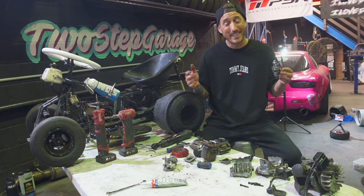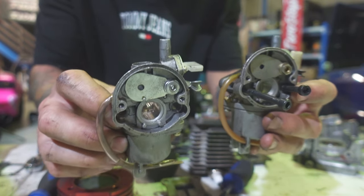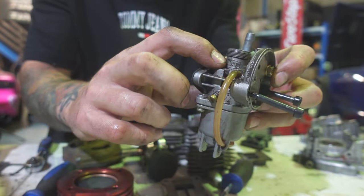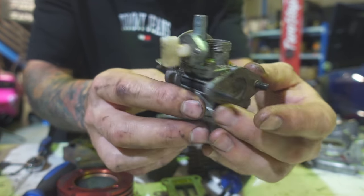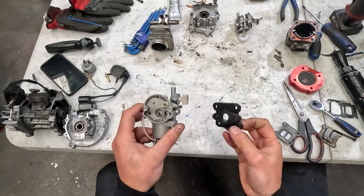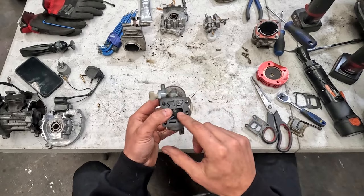The purpose of these motors, just like any motor, is getting as much air in and out as efficiently as possible. We're going to start at the back end where the carburetor is. I've got two of the exact same carburetors here that came off what look like the exact same motors, but they are quite different. One is lighter with lower quality casting; the other has branding, feels much heavier, and is clearly much better put together — that's the one we're going to use. This is our intake manifold, made of plastic but does the job well. When we match them up, we can see there's room inside the carburetor to dremel a little bit of material out to make it perfectly match the port.